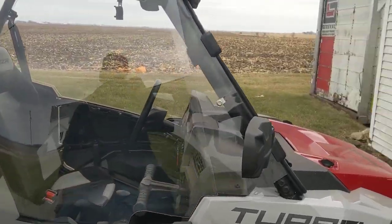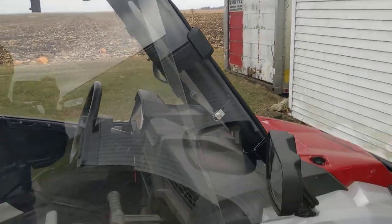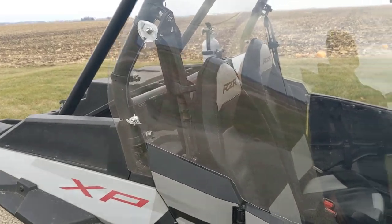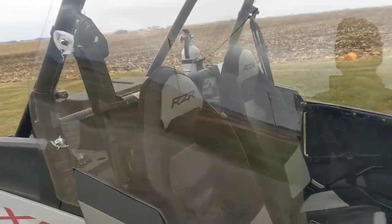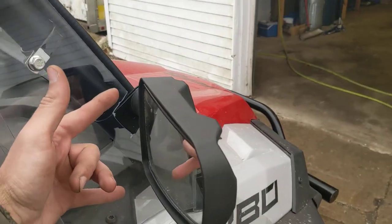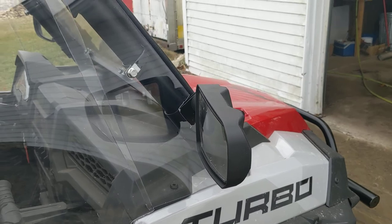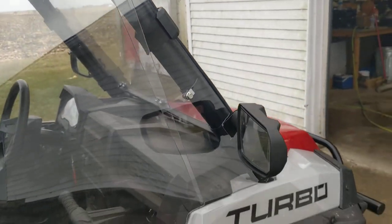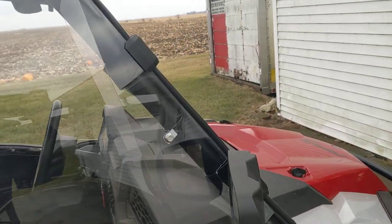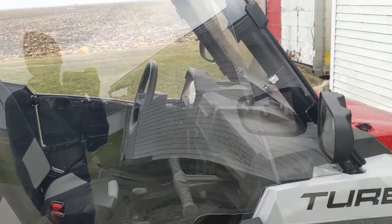The front little portion here I did for a few reasons. One, since they only had 4x4 sheets, that was as big as they went — from here to the back tip. Also for the mirror, otherwise I'd have to have a cutout for the mirror on the door. And also, if I happen to change windshields, the mounting of a different windshield might be different, so then I only have to change this small piece instead of modifying the whole front piece of that upper door.